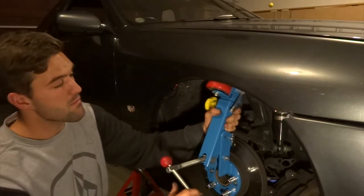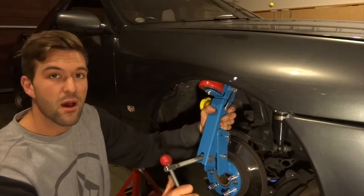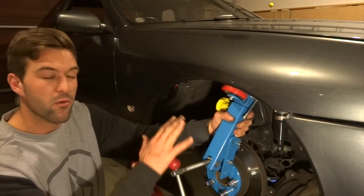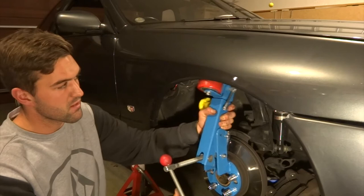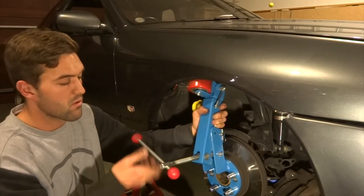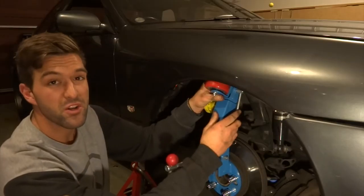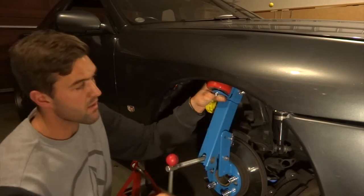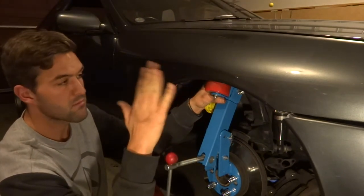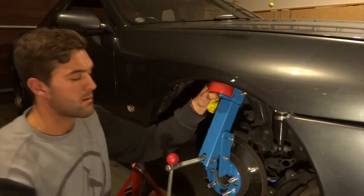What I'm doing now is just feeling it with my left hand and keep turning it with my right hand to keep pressure on the guard. Just feeling with my left hand how tight it is — and then when it starts getting a bit more free-flowing I'm going to go ahead and increase the angle a bit more. Pretty much now we can go ahead and increase the angle of that wheel to its fullest, because I think we're at the point where we can do that final tuck. Go ahead and tighten that up.